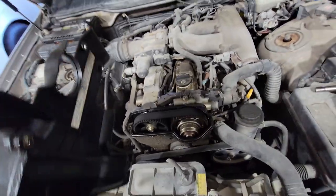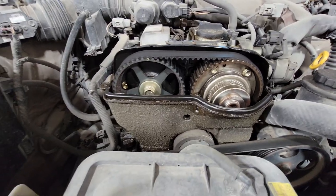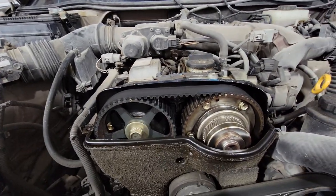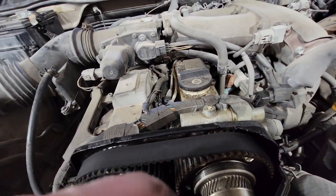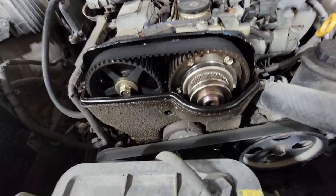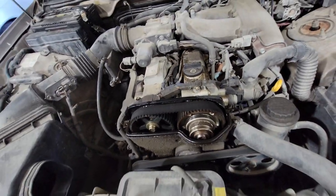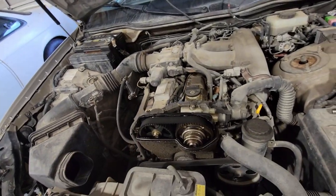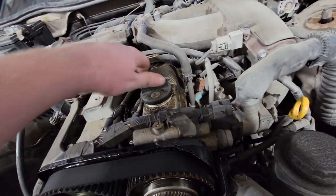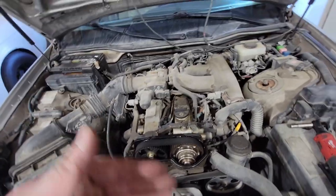This is where you can just start tearing things apart — this is gross. Going to be cleaning everything. That is one clean VVTi gear. One of the telltale signs that it's leaking up top is obviously everything is just gross and wet. My timing belt is not bad — this is actually a new belt — but in the back of the gears it's completely soaked. It's just wet at the top. When you've got a leak like that, if it's leaking in the front main it will just seep down underneath the timing belt and won't get sloshed up to the top. The reason it's wet here is because previous owners literally missed the hole.